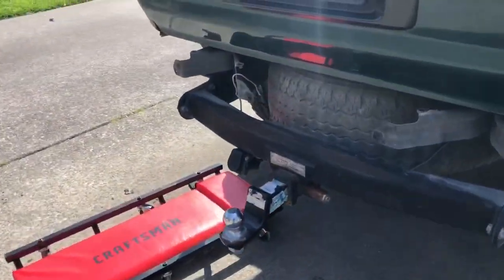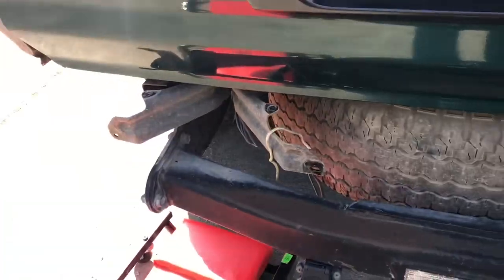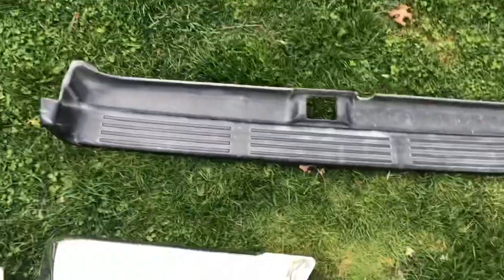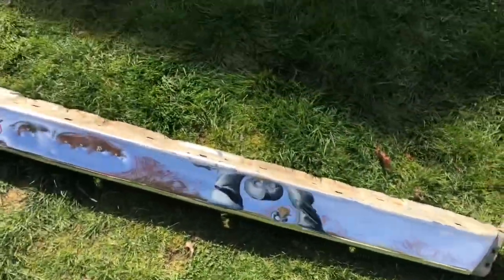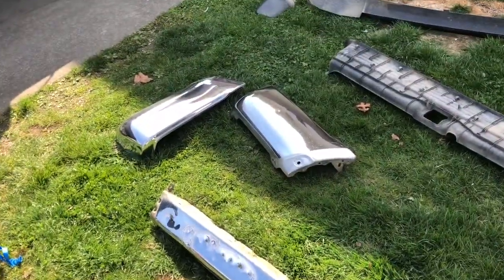Okay, so like I said, there's a couple underneath the side, a couple that go through the top holding that bumper on in the center. And then to get that plastic step piece out for the bumper there, if you look under the back side of it, it's just got these little squeeze clips that go through those square holes on the top of the bumper in the middle. So your rear bumper is a 3-piece bumper. You got the center piece and those 2 side pieces.